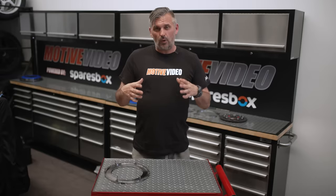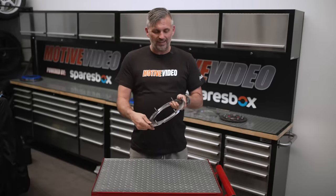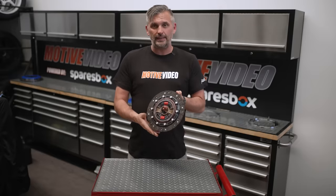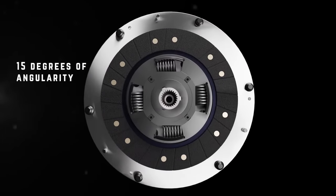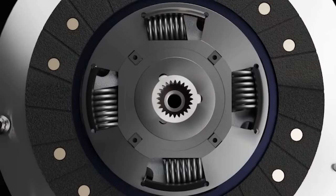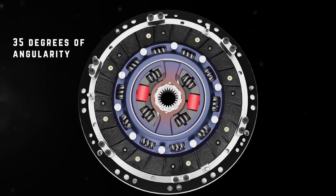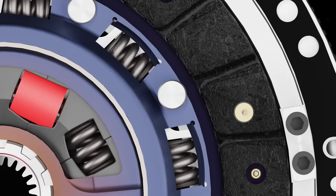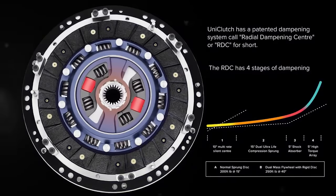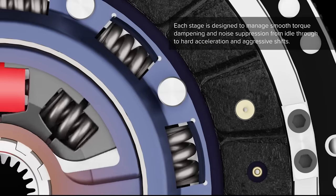As you can see, they've jammed a lot into this lightweight and compact twin-plate clutch design. One thing I really enjoy about this clutch is that it has essentially its own flywheel built in — think of it more as an integrated flywheel. The coolest and most unique feature of the Uni-Clutch is their dampening system on the clutch plate. Traditional sprung clutch plates generally have 15 degrees of rotation available as the spring compresses, and basically the torque required to compress those springs is the most amount of torque that can be dampened. Uni-Clutch has a patented four-stage dampening center — it uses springs both in parallel and in sequence, plus a urethane shock absorber. This means it can absorb a larger amount of torque to dampen the engagement, which makes it nicer to drive. The Uni-Clutch has 35 degrees of available rotation, which is similar to a dual-mass flywheel, meaning the Uni-Clutch is a better option once you remove a dual-mass flywheel.